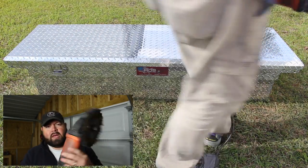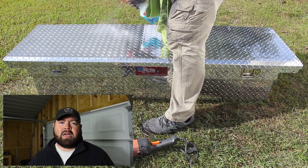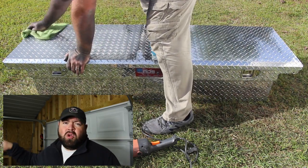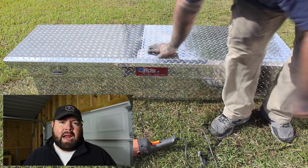That's the tool I use and how to install it. I usually like to take some Windex, spray it over the box, take a clean towel and get off any extra residue from the rouge bar. As you can see, it gets really dirty. So make sure to wear old clothes and make sure to wear eye protection.